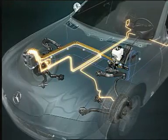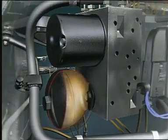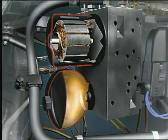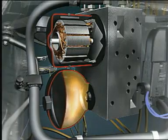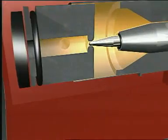The computer uses hydraulic valves to regulate the brake pressure, formed with energy from the high-pressure reservoir. An electric pump generates the required pressure, which is monitored by a pressure sensor. During braking, brake fluid is pumped from the high-pressure reservoir towards the brakes. Pressure sensors measure the applied brake pressures, which are then regulated individually for each wheel by the hydraulic valves.